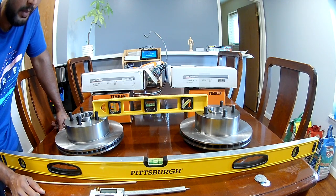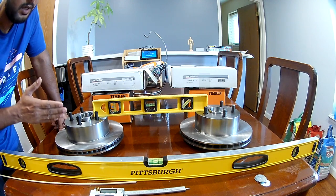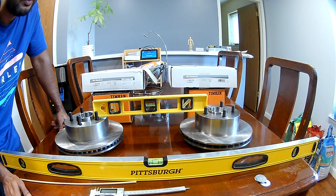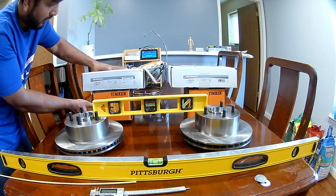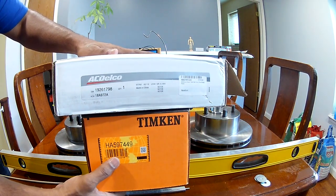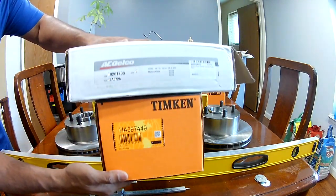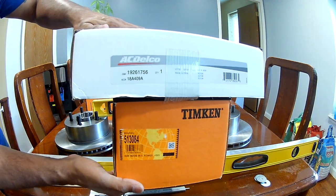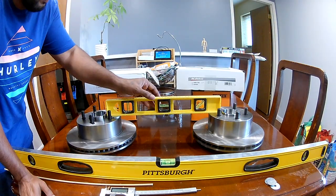That inward shift would affect front wheel alignment — your front wheel would be about 3.67mm inside. I don't know whether that is a huge problem or not. Buying both sets for this video: this is the latest model hub and latest model rotor — note the part number. And this is the older model of the 1999 year with the older model rotor.